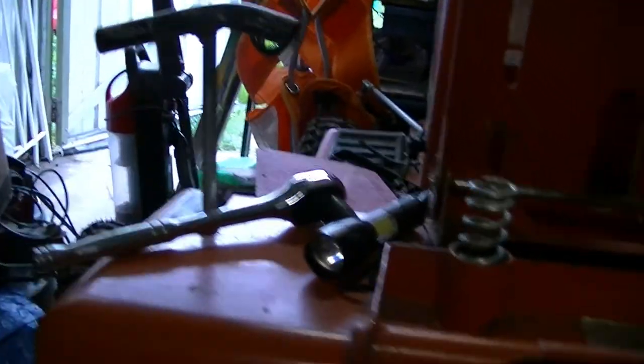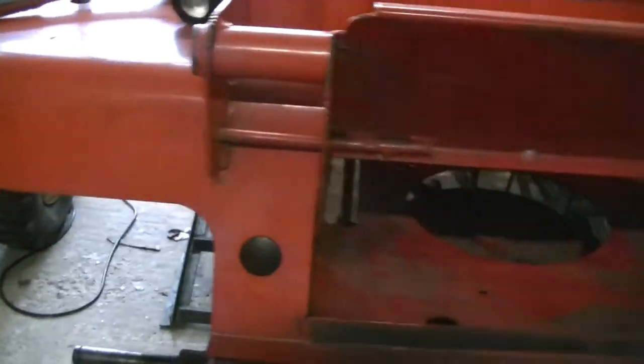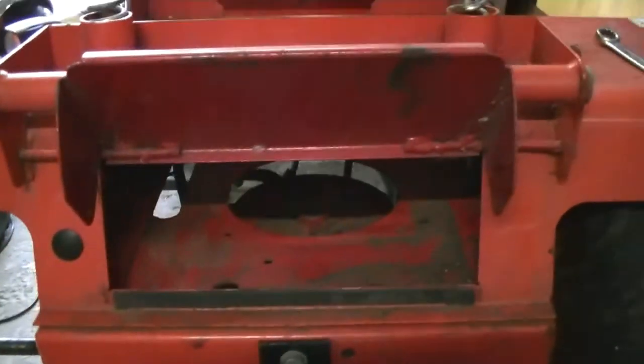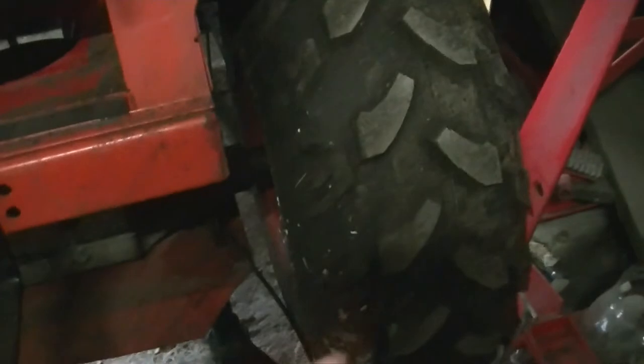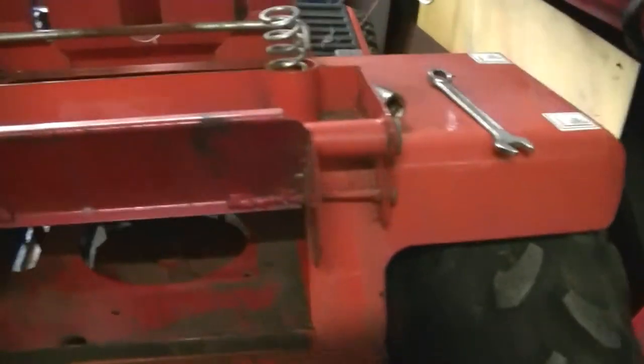As far as I can see, we've got to disconnect the gear lever. I'm going to do it down here because we've got the T-handle on this one, and it all connects and goes through here for the side panel. In the wheel arch there are two bolts on either side. I'll get this wheel off and hopefully it's four bolts and we're off.